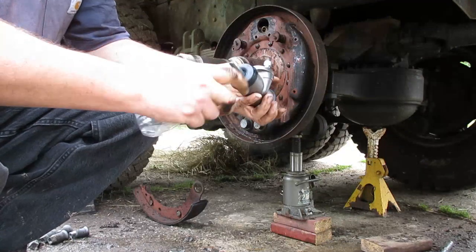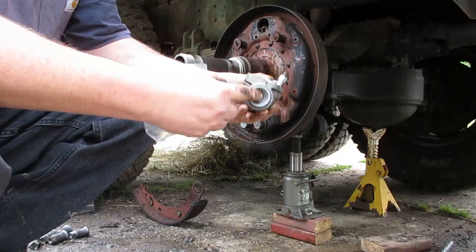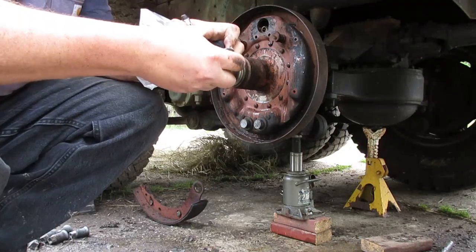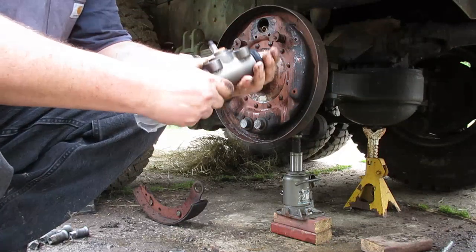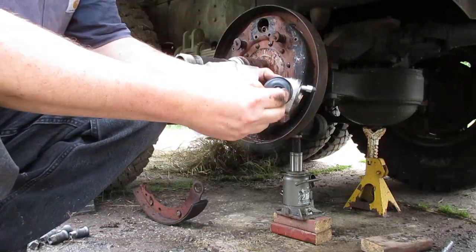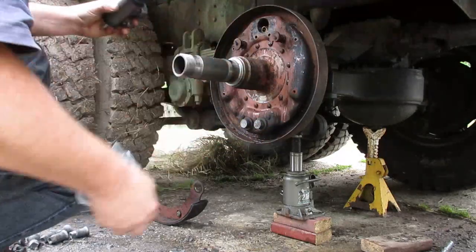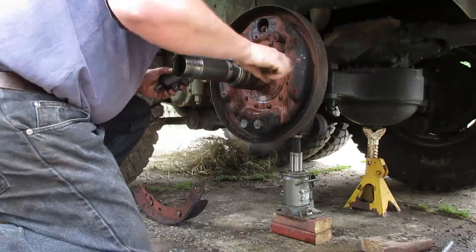That's what pushes your pistons. Oh, look at that. Nice how smooth that is. So there's usually a spring in there, and that's what pushes your pistons apart. Keeps tension, because even though the shoe comes out, you always want that tension, otherwise the shoe could miss your notch, and then everything will go cattywampus on you. So I'm gonna go ahead and put this in.